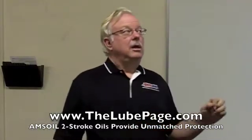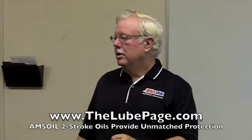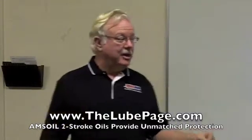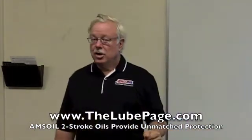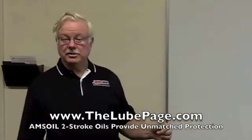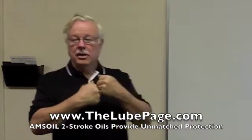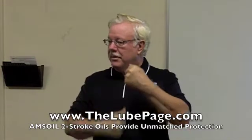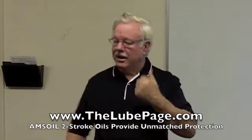Now, two-stroke engines do require more anti-wear additive because it's real hard for that thin oil and gasoline mixture to actually keep those metal parts separated. So if I can get some zinc or some phosphorus on the surface of the metal, at least then when the metal tries to come together, it'll hit this sacrificial product of zinc or phosphorus and not go metal to metal. And by the time it comes back again, maybe I got more oil back on it. So it's just constantly fighting that battle.